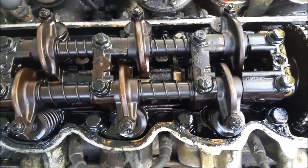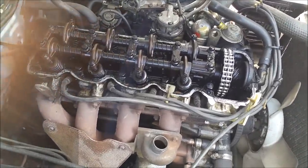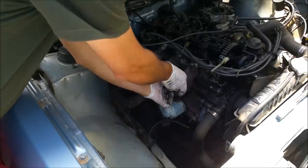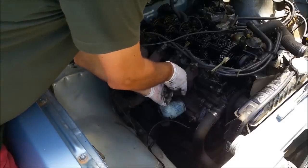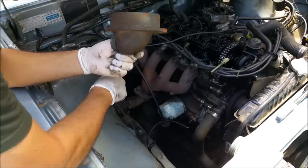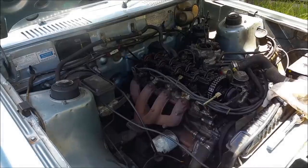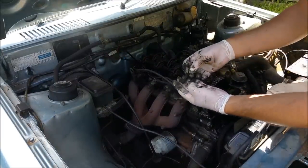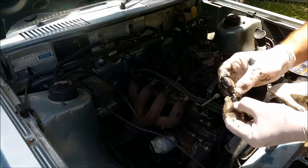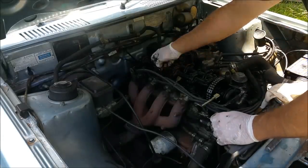I just want to make sure that cooler isn't going to present too many problems beforehand. I think we'll need to get the rocker gear off and have a look at those valve stem seals, but only after we've ascertained that the block is okay. Not a bad looking sort of semi-header - a bit like a 186S where you've got your dual engine pipes. That all looks pretty good in there. I keep pulling silastic out in chunks like that - this stuff is bad. Used like that is really not good, less is more. You don't want oil pickups or galleries blocking up with this crap. The motorcycle engine - the 350 four-cylinder - had it on the head gasket and that will block your oil galleries going up to the head for lubrication. Your intention's good but you'll fry an engine. There are so many better sealers around now that are so superior. One of them is Honda Bond, which is a very thin solvent-based sealer - you just use a really light smear, and a tube will do a whole engine.